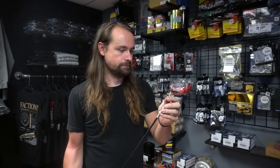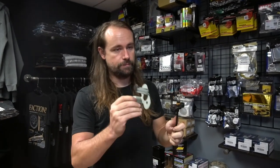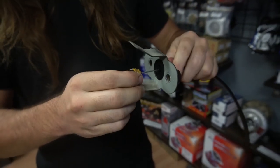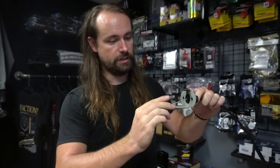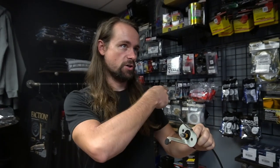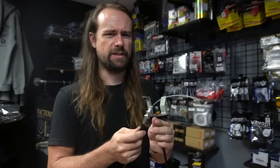While I was doing R&D with this throttle cable bracket, we found out there's another factor that can change the position of your throttle cable threads in the engine bay. It's this piece — it connects like this and it is inside of the car; this is where the throttle pedal connects to the cable. You pop this into the throttle pedal and it's like a pivot: when you hit it, it pulls the cable back; when you let go, the throttle pedal rests on this rubber piece.